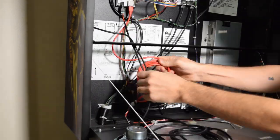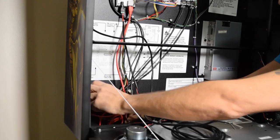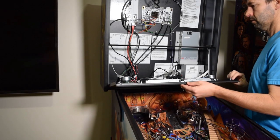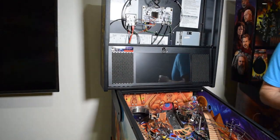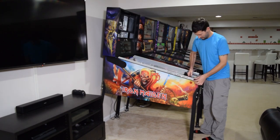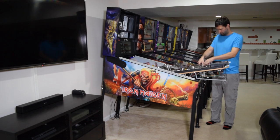Here is how it should look when properly connected. Next, grab the Ethernet cables and feed them into the pinball cabinet using the hole on the left side of the back box. Go ahead and raise the speaker panel and lock it into position. At this time, install cabinet protectors if you have them and then partially raise the playfield. Remove the pinballs from the machine at this time.